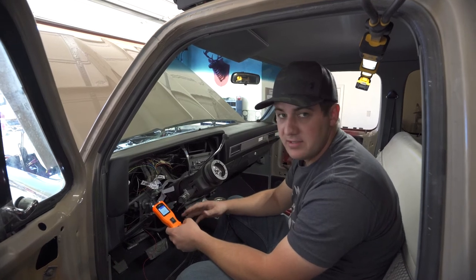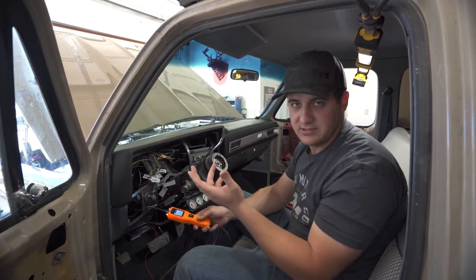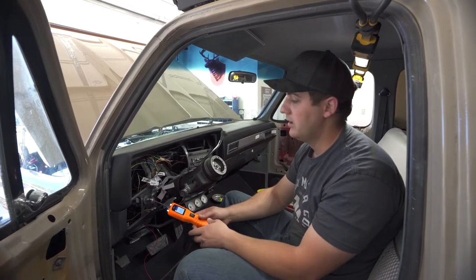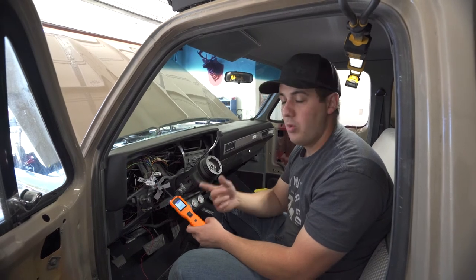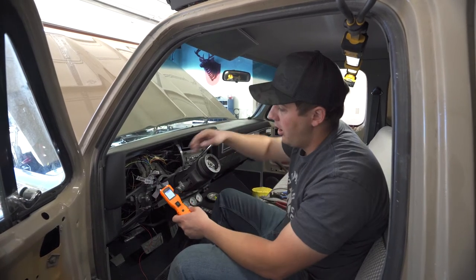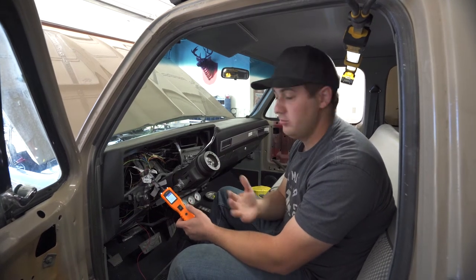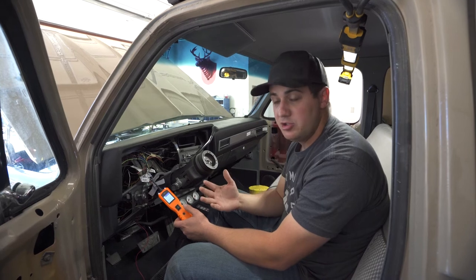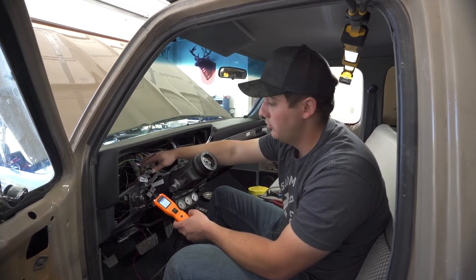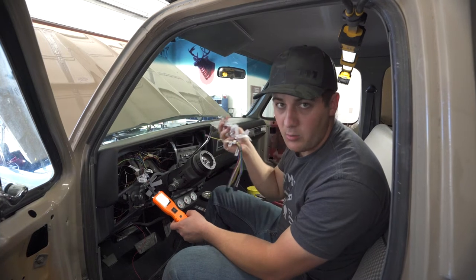Next, you're going to probe the rest of your wires to find what you need. If you've already ran your sending units, you're going to run those wires through the firewall and you'll know what those wires are because you'll know what color you used. I would suggest using blue for water temperature and a different color for oil, a different color for tach, and a different color for speedo. Probably the one wire you're not going to run into your engine bay is the factory fuel sender wire — on a square body Chevy, the factory fuel sender is a pink wire. If you look up your truck and search for gauge cluster wiring, you should be able to pull up a schematic that will tell you what color wire goes to what. You'll probably end up just reusing your fuel sender wire as it's ran through all of your factory loom.